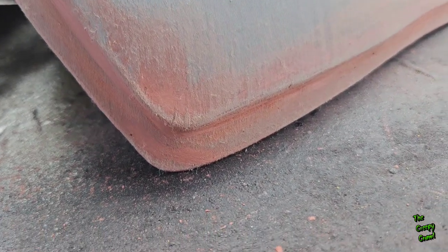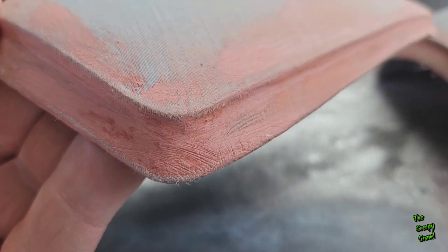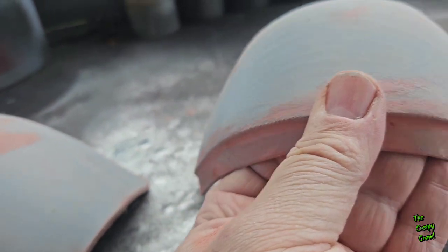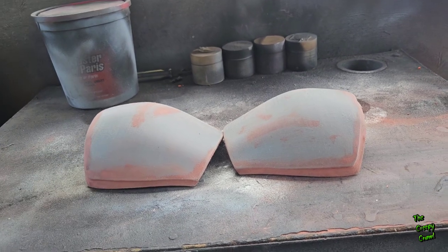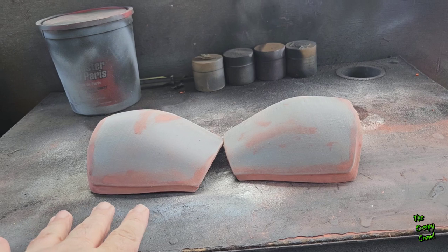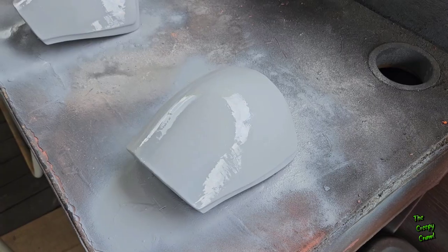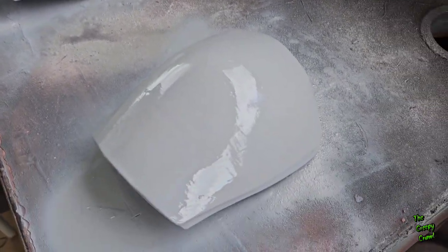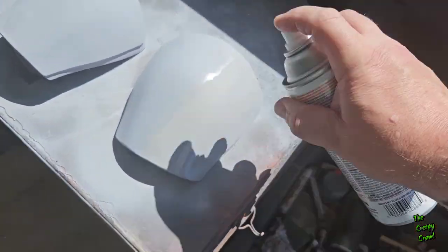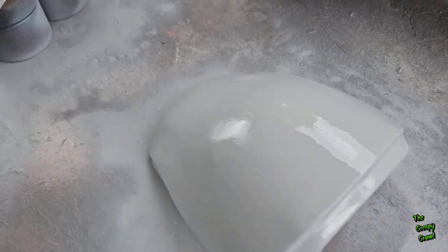So far so good — this is my first go around. You can see some problem spots in the corner, but that's really about it. I just have to clean the parts and maybe sand just a little bit more in that corner. Then I'm going to hit it very heavy with filler primer — automotive primer — literally layering all this stuff up until we get a nice smooth finish. It's a lot of sanding and repeating the same process. Three or four really wet coats all at once, then I'll put a box over and let them dry, give it a couple more, and then we'll look for the true trouble spots.